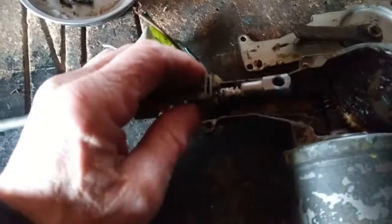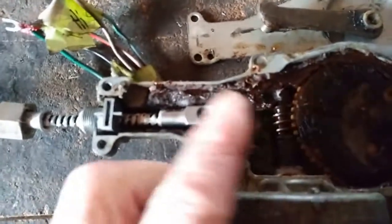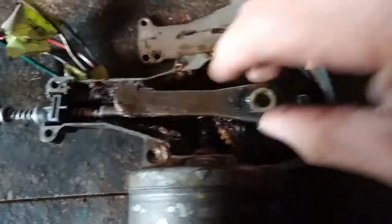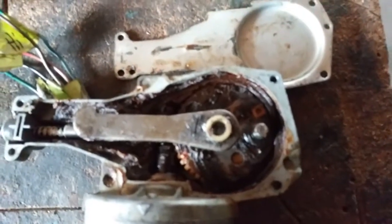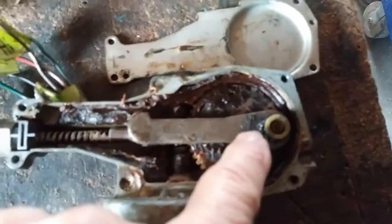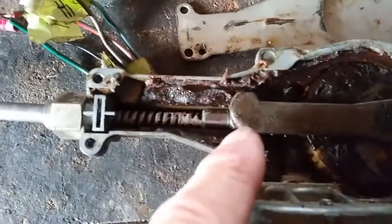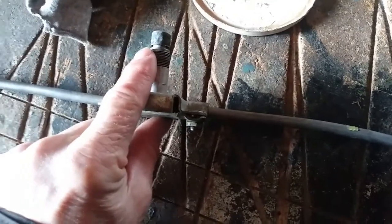This whole thing just fits on the end — the flat end goes up, fits right down in there, kind of tight. Then your arm and its shaft goes right in there, and then you have to pull your cable out until it reaches over here. You can see the fulcrum, and it will push and pull the cable back and forth, which will rotate the wiper actuators.